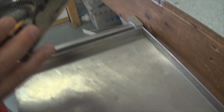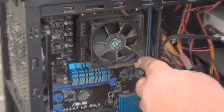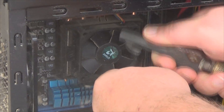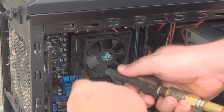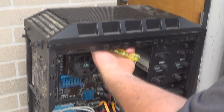Look at that video card — it's junk, don't listen to that hair guy. As you can see here on the CPU fan, there's a lot of dust right underneath. You've got to hold your fan still as you blow the air out — you can watch all the stuff fly out. Then you can hold your other fans as you blow.